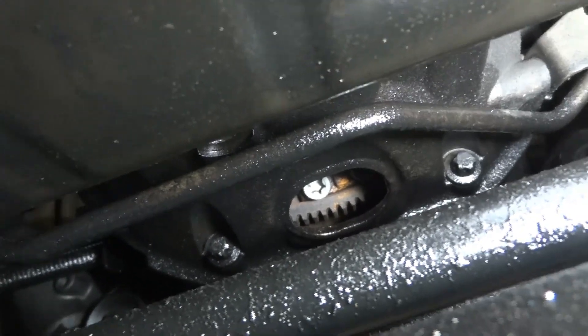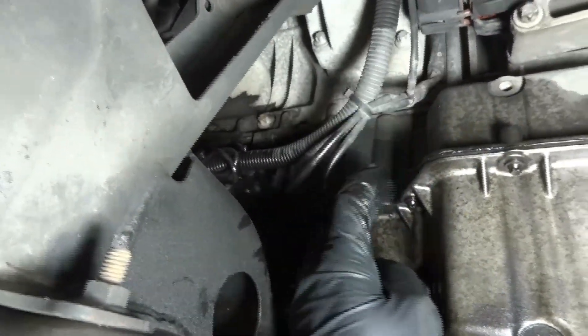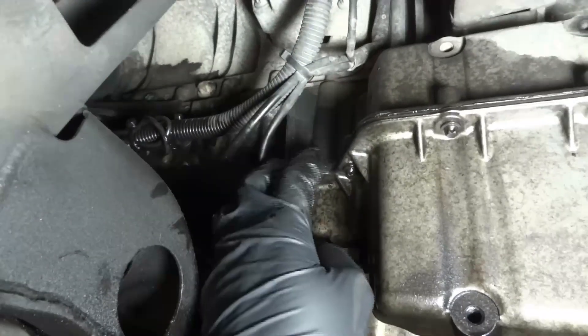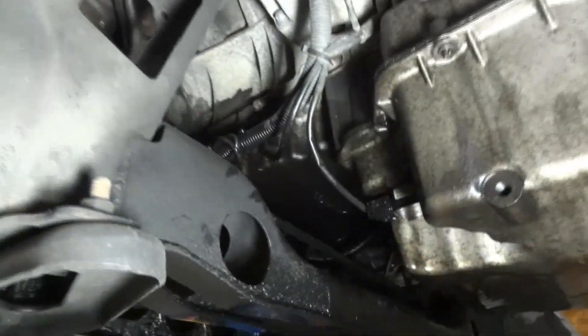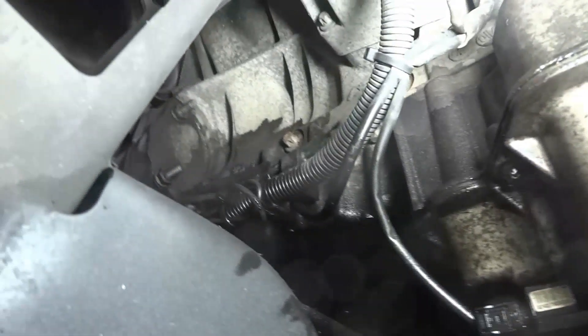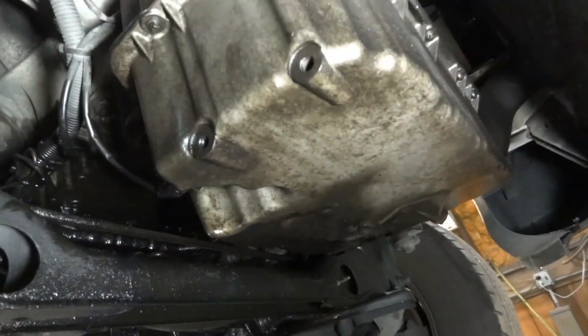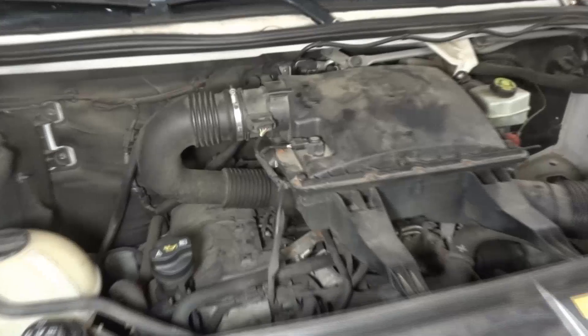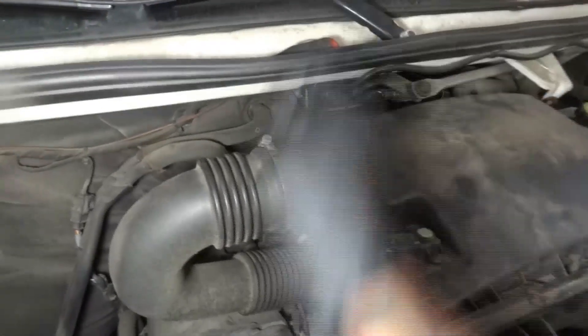Look at the teeth on the flex plate — they look dry. But all around here it's wet. So now I'm going to lower the vehicle. We definitely have a leak over here. I'm going to have to let Sean know we're going to have to seal this lower oil pan. But the other oil coming from up there, I believe it's coming from the oil cooler. Let's lower the vehicle so we can confirm that. I'm going to remove the air filter box so we can look around the oil cooler to see if our leak is coming from the oil cooler.